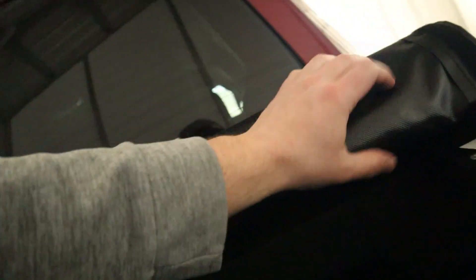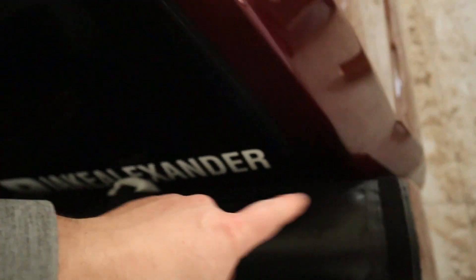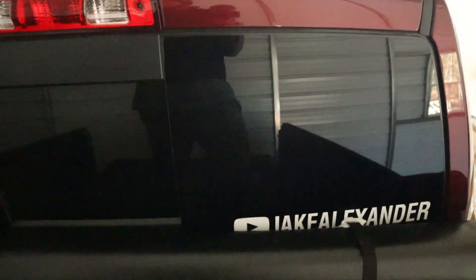I got the bulkhead in here — it's literally just like a channel. You slide the little channel thing into this channel right here, and that's how it marries the two together. I put my foam down — I ran the foam and cut it right where the bed liner line stops. There is a rubber gasket underneath it, so I'm not trying to keep it air tight. There's probably going to be some water that gets in, but that should be more than enough. I did that on both sides. Clamps still aren't super tight — I just want to roll it out and make sure it locks, fits, and my tailgate can shut.